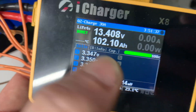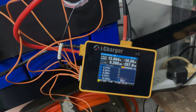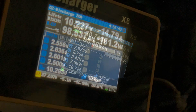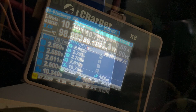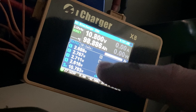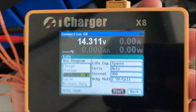Changed the settings to 20 amps — let's go again. The second load test is finished and I saw the spread get out to about 160 millivolts. Cell 4 — the one on the left — seems to be holding the battery pack back, but we got 98.8 amp hours out of the battery. Again, that's within the margin of error.